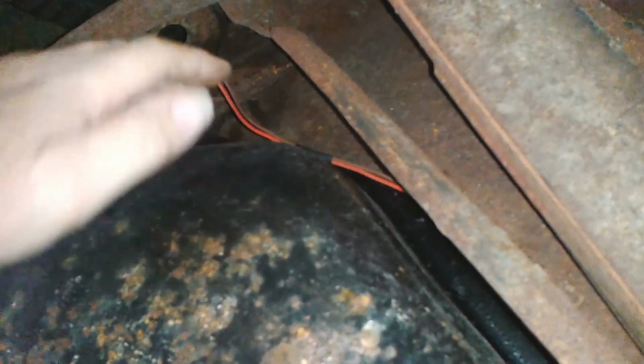Hello, I'm under my coupe. There's the petrol tank. Oh, looks okay. Looks a bit crusty here. Okay, we've got brown and red there. That's the rear lights that side. So I'm trying to work out where my wiring goes. There's brown and red, and I've got brown and red there for this side. So the reds go to red, brown goes to brown, and that brown goes to green. So green and brown are the indicators. Green and brown are the brake light filaments and indicators. Red is the rear lights.